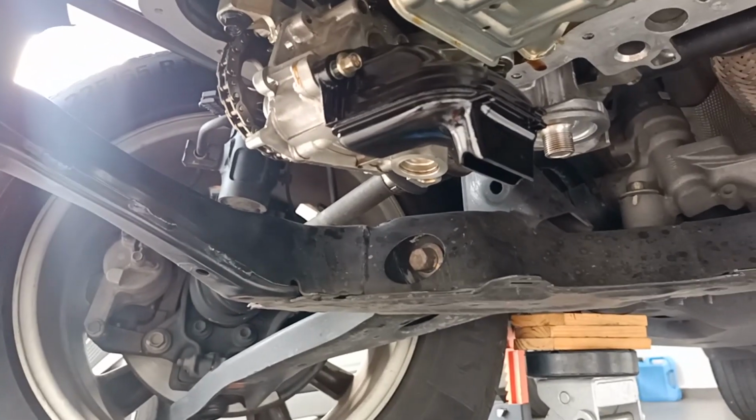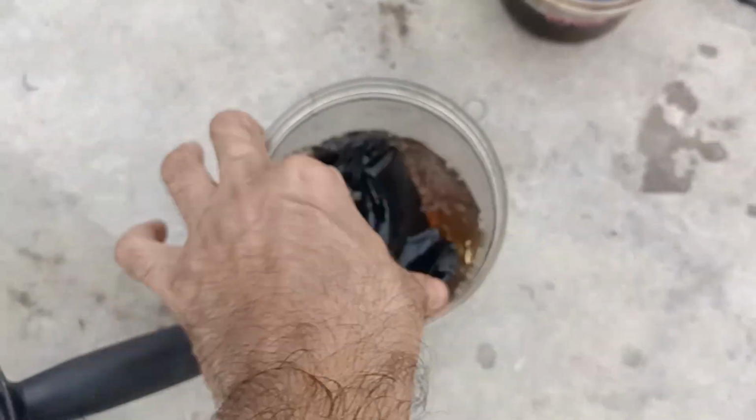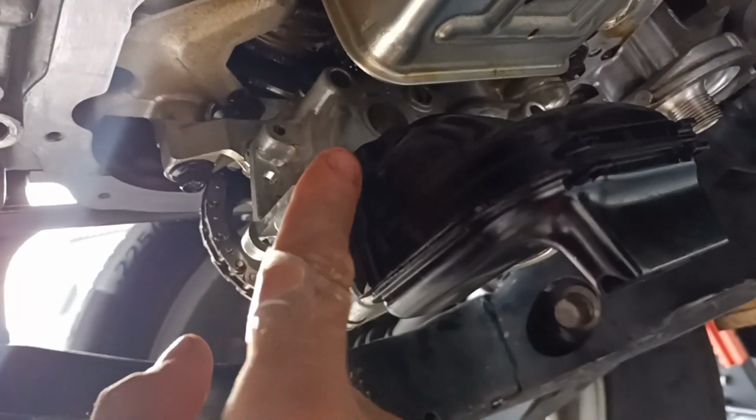As you open up the oil sump cover, you will see this back here. The oil will be forced through inside here. There is a filter element inside here. If you want to change it, just slide it through, one here, one on the other side, remove the side, slide it through, just gently out. Okay, so this is oil GF30. We are going to change the O-ring which is mounted here, because the old O-ring is already hard. We have tightened up size 8.